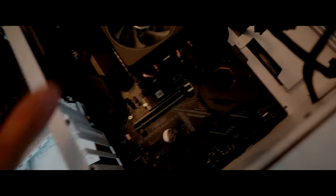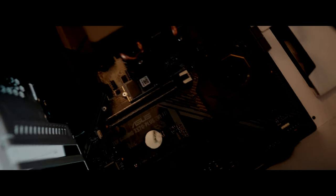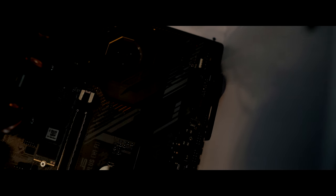She's finally done — let's go hook her up and see what all the hype's about. The PC was fully built and then it wasn't turning on, so I wanted to let all my PC builders out there know: if you just built your PC and it's not turning on, here are a few things to check. Make sure your RAM sticks are securely in. Make sure your CPU socket is securely in — with AMD there's a lever you want to make sure you switch. Make sure you use the 4x4 pins for your motherboard and have that securely plugged in. One of the big things I realized I was doing wrong was my power negative, power positive, power switch for the case was wrong — make sure that's right so your PC can turn on.